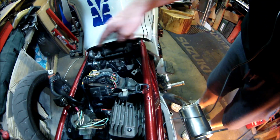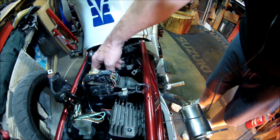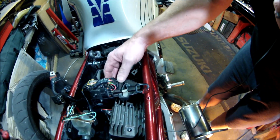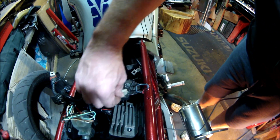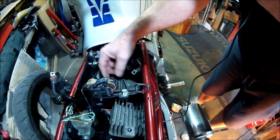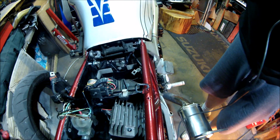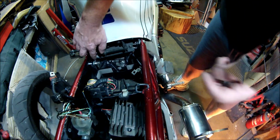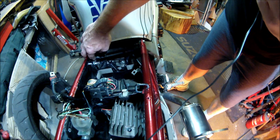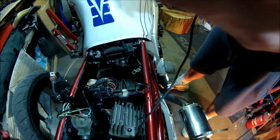So that's the subframe actually bolted in. As I say, now I've got to get the bracket across here and cable up the seat release. That's better. I knew it wasn't sitting properly. Such an amateur. That wants to go that way. Do you know what? It's better crossed over. It's a bit tighter. We like it tight. Right, so that is definitely in now. Wires down there. So yes, seat release bracket. Cocked up there. Didn't need to bend that bracket anywhere near as much as I have, because this plate goes in behind it.